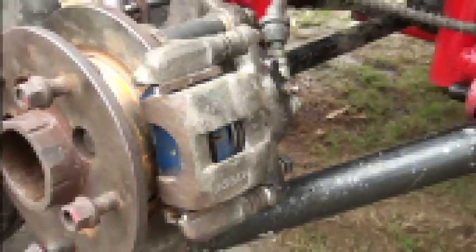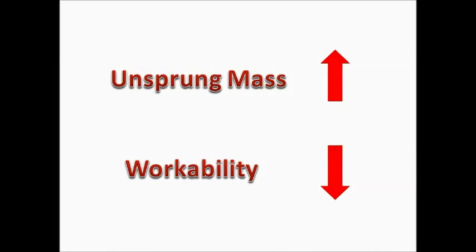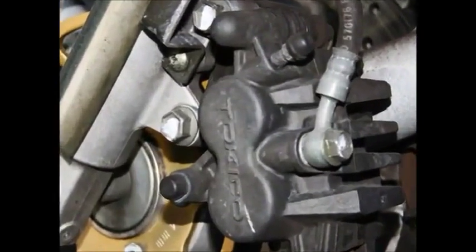which are not only heavy but also take up a lot of space in the wheel component, increasing unsprung mass and affecting workability. To reduce weight and conserve space, many teams go for motorcycle brake calipers, which are designed for brake discs of large diameters.